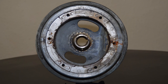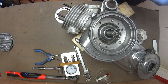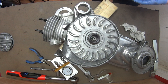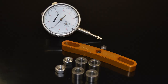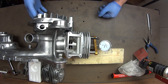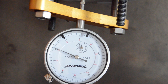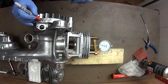Time to look at the flywheel again. Here you can see the sorry looking original 6V item, and here's the 12V upgrade one from BGM. The reason for getting this out again is to mark the top dead centre position on the mag flange. The top end setup is radically different from the original, so there's no way the TDC position would be the same. Re-fitting the barrel with its packing plates and inserting a woodruff key into the crankshaft, I now firmly attach the flywheel. Using a dial gauge tool bolted in the place of the head, slowly turning the motor over, I can watch the dial to find the piston's apex. I turn the motor over a few more times to be sure of my readings. Using a blade and a marker I can accurately leave a mark in the mag flange at the new TDC position.